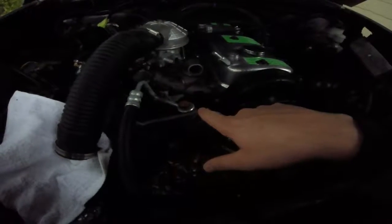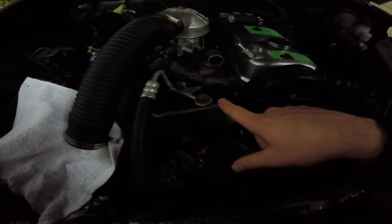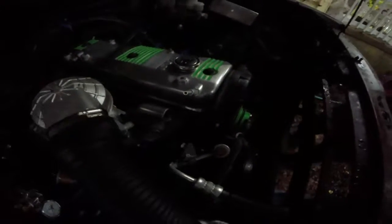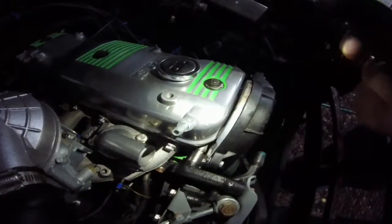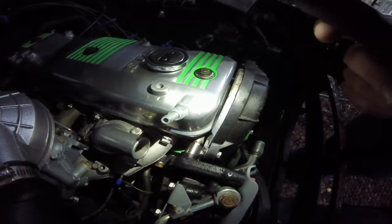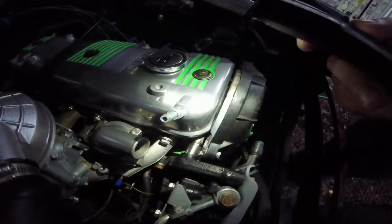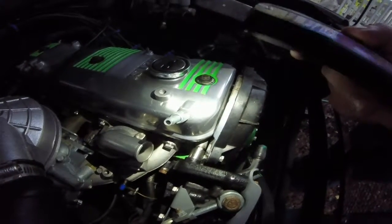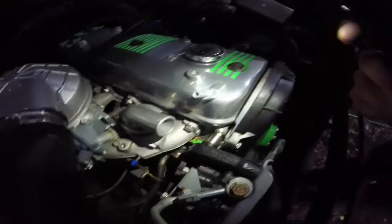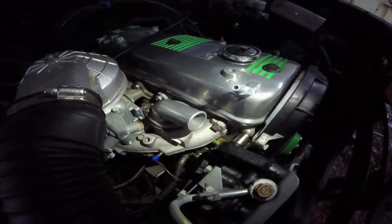We did a real basic rebuild on our power steering pump here. We're going to be offering these parts and kits because I couldn't find them anywhere else. Down in this corner we've got our stainless standoff for the power steering pump and our stainless stud kit. I was just tired of fighting with those things — having them break, not knowing where to get anything, or people just cramming a bolt in there. A bolt can work, but this is my preferred way so I know we won't deal with rust. These bolts and nuts for the intake are actually stainless, as are all the washers.